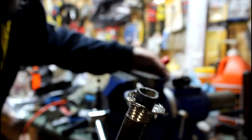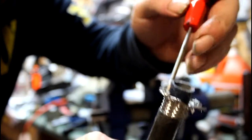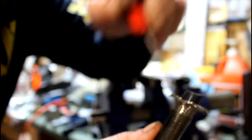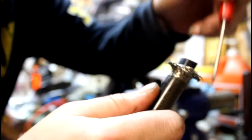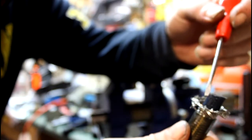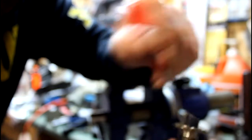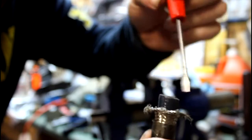I take just a screwdriver, go in there and just kind of work the steel mesh down, kind of flay it out a little bit. As you can see, you kind of work it down, just work it all the way around. Because what you want to do is basically reveal the inside Teflon, so just work it around.